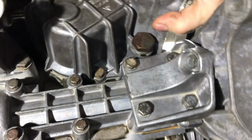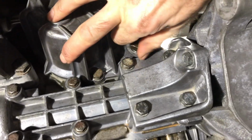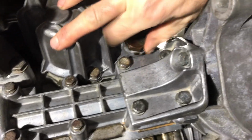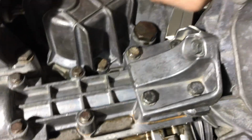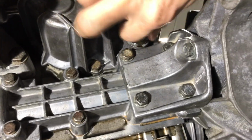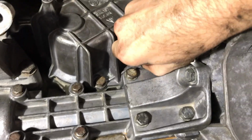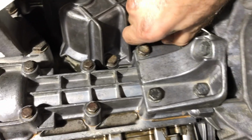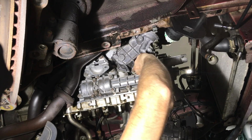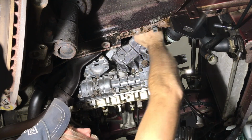But because I had that problem where, depending on where it was, the tool and/or the relief valve didn't seem to be perfectly straight in its bore, I did this with just the pressure valve itself. I tried to make sure that that was in there good without binding, and then ended up tightening it down kind of. I went back and forth between the cover and the pressure relief valve itself until everything was seated and seemed correct.